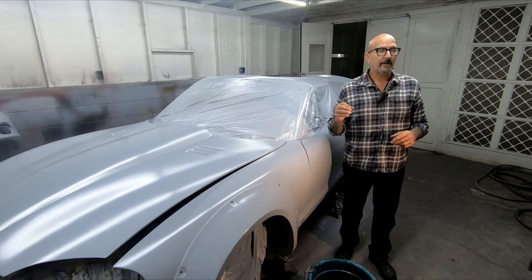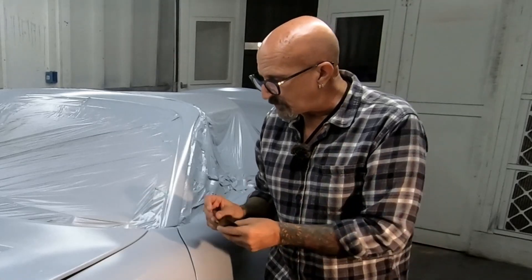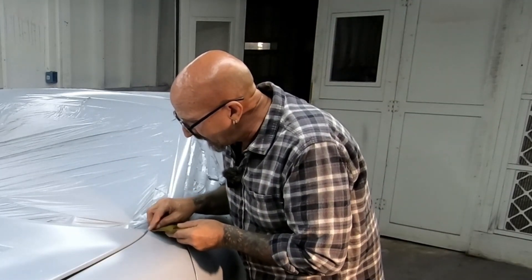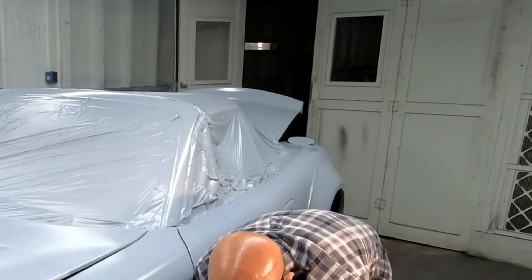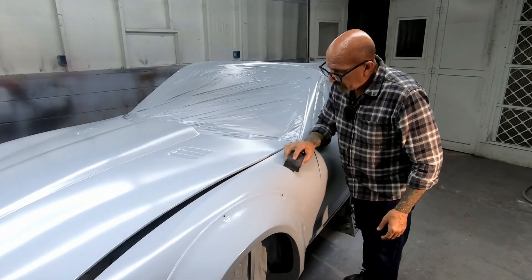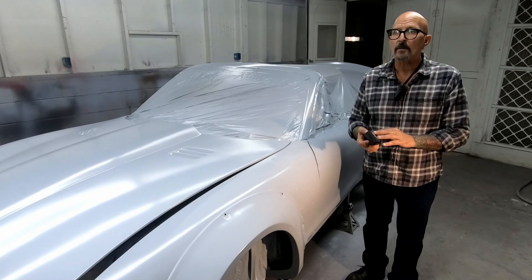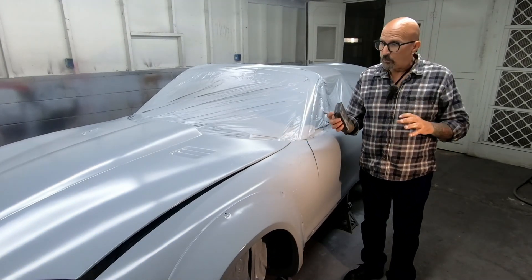Here's what we're not going to do: we're not going to take sandpaper and just use our bare fingers and rub it on the car. There are spots where you'll have to carefully work something, and you can do that for little tiny spots and edges. But generally speaking, if you're touching the car, touch it with a block. Start working the panel and you'll feel it — when it still has texture, it really grabs the block, but as it smooths out, the block glides over it and you'll really feel that difference.